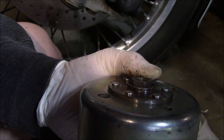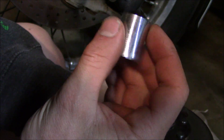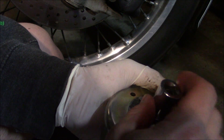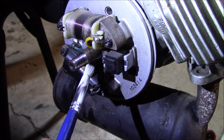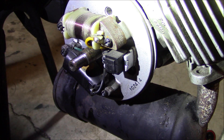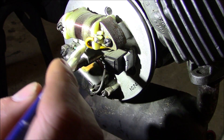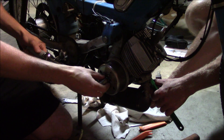This is an M10 by one thread pitch and the socket that fits best is this five-eighths that I sanded flush, so it's extra sharp and should work nicely to torque it. First I'm going to put some anti-seize on the tapered portion of the crankshaft and then some oil on the threads to prevent everything from getting any rustier. One tricky thing about these CDI kits is you can't fit the cover on anymore, so everything is exposed to the elements. I've got my lovely assistant holding the clutch bell and now I'm going to torque this thing.